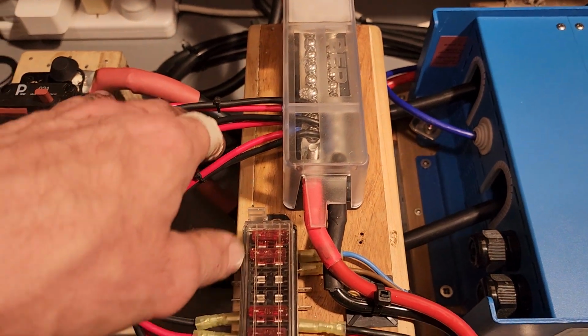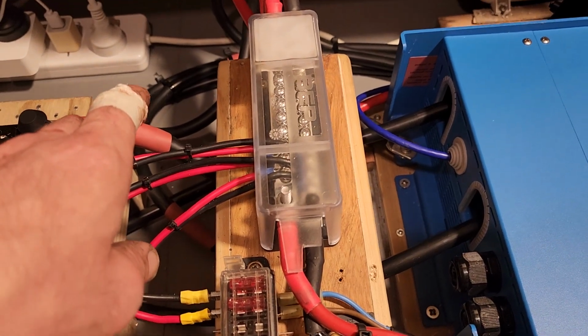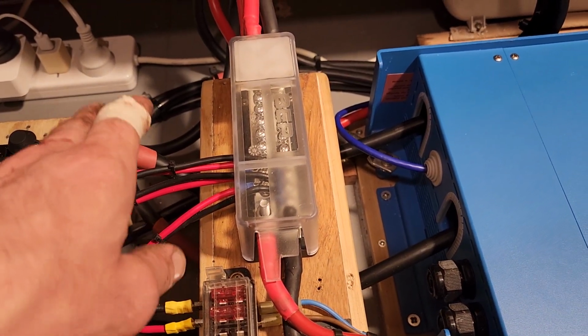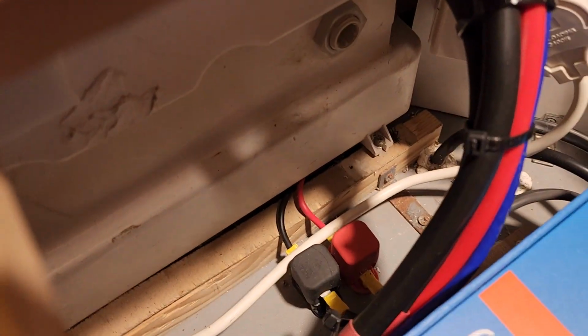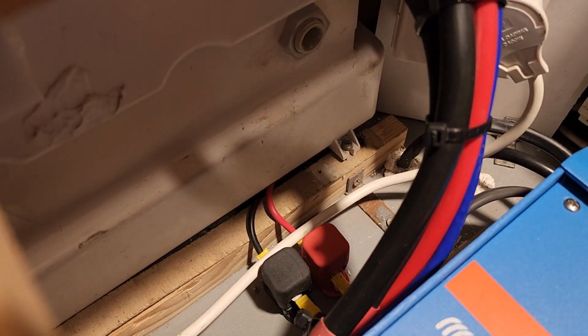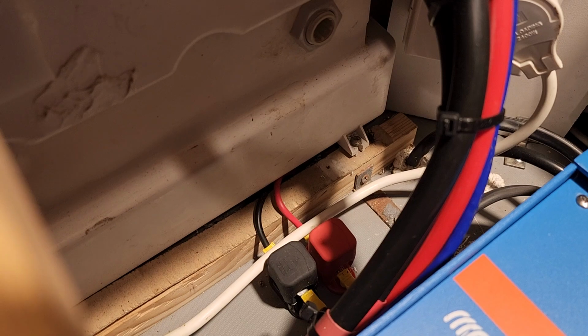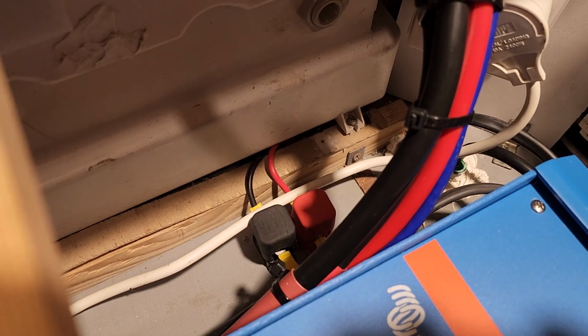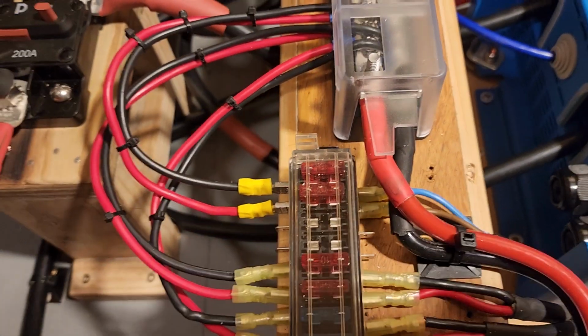And then everything from the caravan. One of the main problems was that one of the main connections to the 12 volt system was quite dodgy, and I created this little setup for its new connection. I bought 2 little mini bus bars, hooked it up into those, and then hooked a new lead up into the opposite end, of course, and ran them around and back into this fuse box. So now my 12 volt system is working better than ever. It's not playing up or anything.